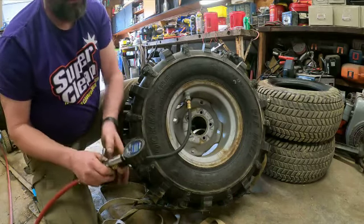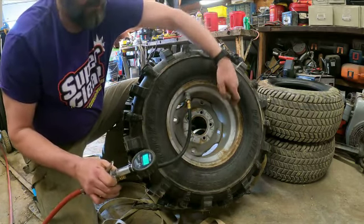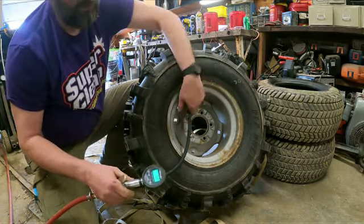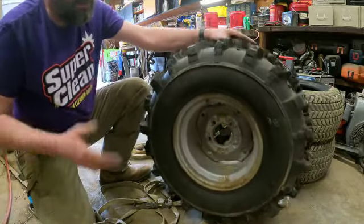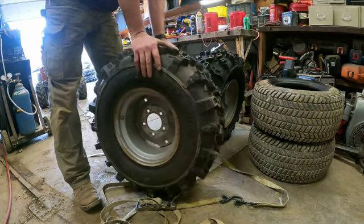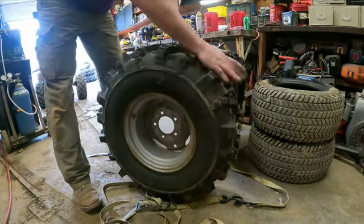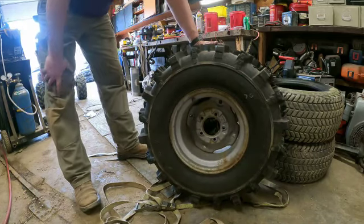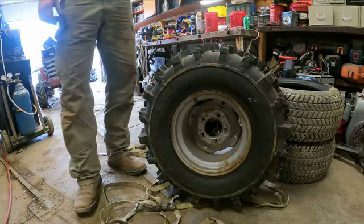All right, that tire's set. Now what I do - from where it's set, that means in my opinion it was the loosest spot and it blew that tire up just enough to put pressure on it to set it. Because it seals here - it seals under here, not on the outer edge - anybody know that? So anyway, it took 12 and a half psi. I'm going to bring this down to about eight or nine so that tire starts compressing onto this rim but still has air pressure. All right, we're about at nine, that's fine. So let that sit at nine while I do the other tire. You can do the fire thing, you can buy a bead blaster, blah blah blah. I don't know, sometimes I'm cheap. But that tire is on - it is on there. Normally it doesn't take three straps, normally one strap you work around and you can usually get it, but these tires are pretty narrowed up and it's not super warm out here. So I'll battle the other one and that'll be it.